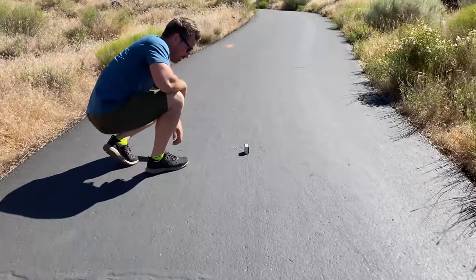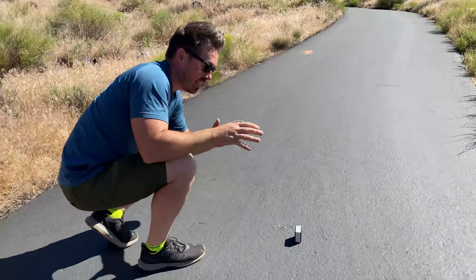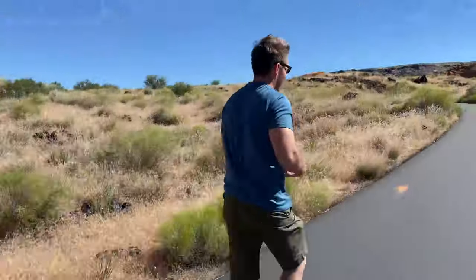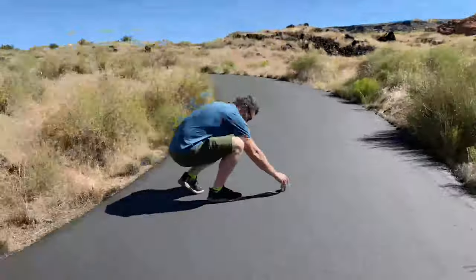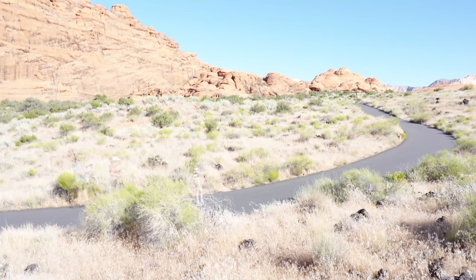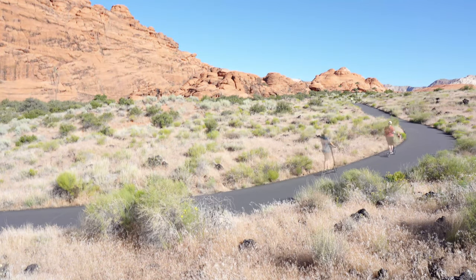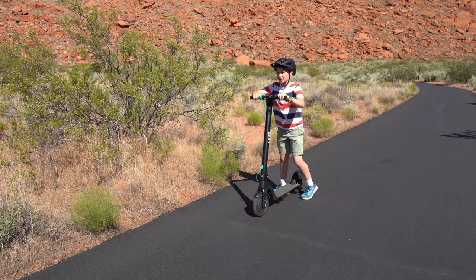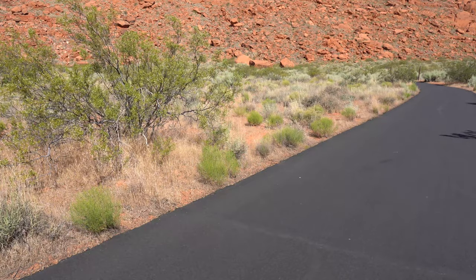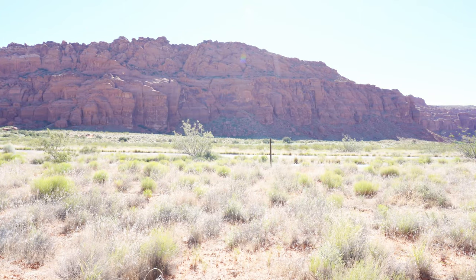Before things went south, I filmed a hill test. The grade measured 10.7% — 0.7 above the scooter's highest rated incline of 5–10%. Other measured grades were 9.8%, 10.3%, and 8.8%. I had my nephew and sister help to show how it handles with different weights. I'm the heaviest at 180 pounds, and I maintained about 7 miles per hour going up the hill, so it does slow down quite a bit even when working well.